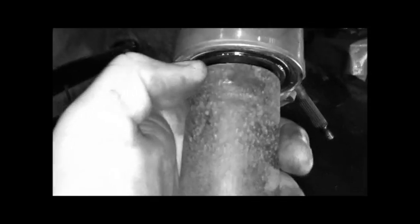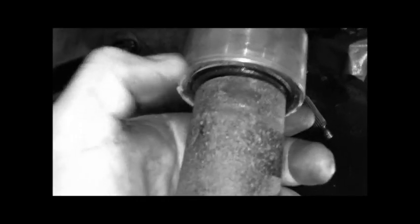I know if I was putting in a brand new one, I'd be going on the outer race by using a bigger size pipe or double stacking washers. I actually have washers that fit perfectly, or I'd get rid of the sleeve altogether and put a socket on here.